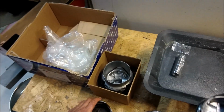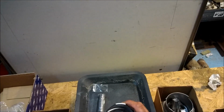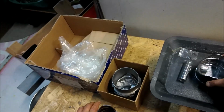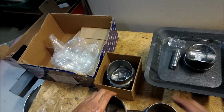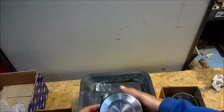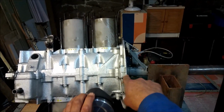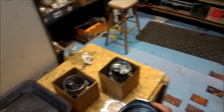As you can see on the old piston, you see Mahle and so on, and here it's just blanked out. It's identical in construction. You see, there are those little springy plates for the oil keepers. Now, these pistons have got an arrow. The arrow goes to the front of the engine. Let's not argue about this. That is the front of the engine and it goes that way. Why is this important? Because as you can see, they're asymmetrical there.